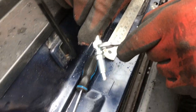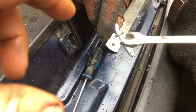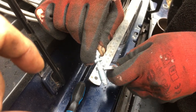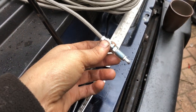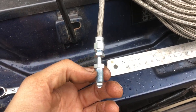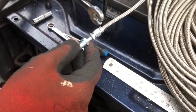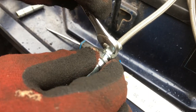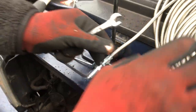That's an 11 mil on this out, and 11 on the other side as well - so it's all size 11. You need to put a spanner on the back too, because this part here moves up and down, which gives you a bit of adjustment if you want to rearrange the hose. This part moves up and down - that's a good feature. You're going to have to use spanners on this definitely. Just literally screw this together holding it with another size 11 spanner, and that's your fitting on.